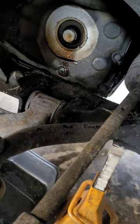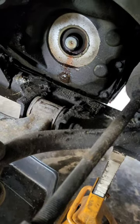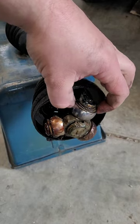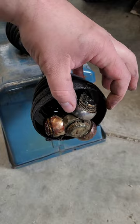One other sign is if you've got this big greasy buildup somewhere around where the CV rotates. That means the boot's coming loose and it's losing all its grease. When they lose all their grease, these rollers start to run dry, and when they run dry and out of grease, you're going to have excess temperatures and problems.